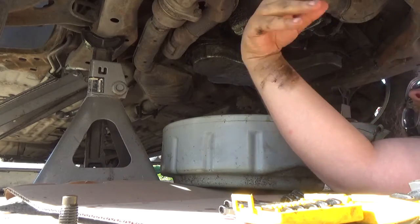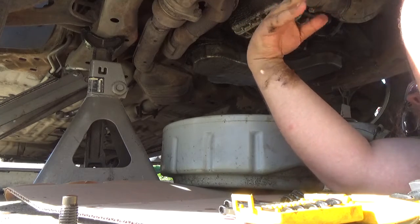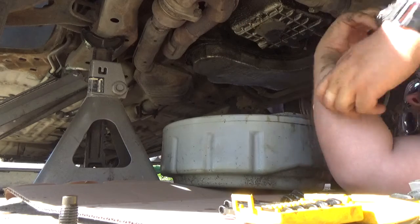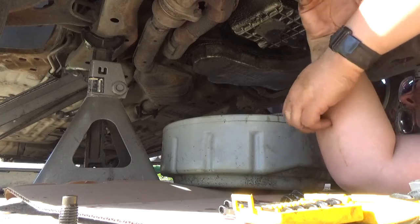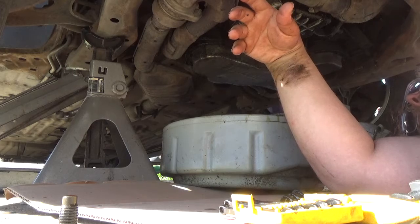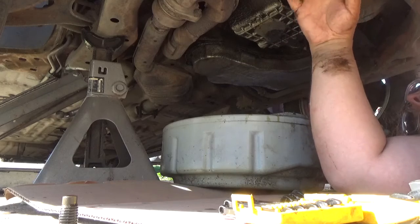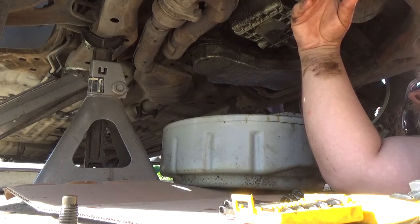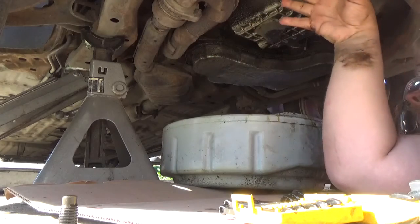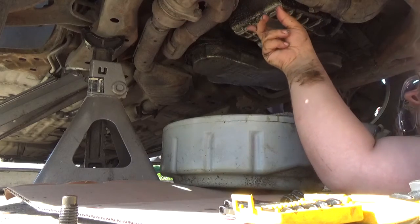So now, when it comes to actual oil change intervals, realistically, for general everyday driving, I still recommend the 3,000 mile method. Every 3,000 miles, get your oil changed. I don't care if it's synthetic or if it's that new once a year oil change. For me, oil's cheap compared to an engine.